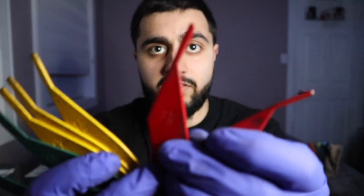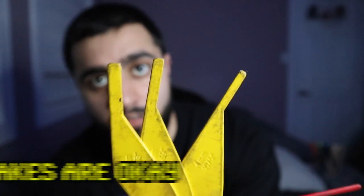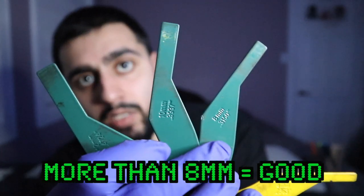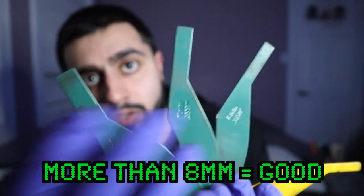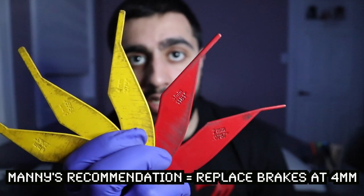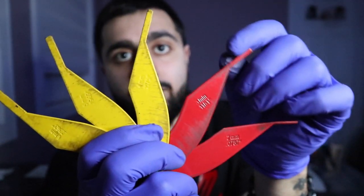If you're nervous about touching your car and not confident putting it back together, don't do it. Just look at your brakes and make sure they don't look too low — make sure they don't get into the red. In the red there's barely any thickness — that's 2 to 3 mil. The okay level is 4 to 6 mil. The good range is 8, 10, and 12 mil. I usually recommend changing your brakes when they hit 4 millimeters — that's when they're getting low. At 3 mil, you have to change them.